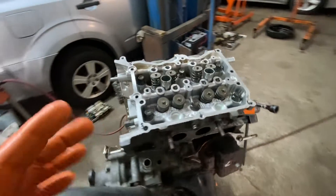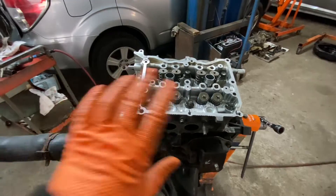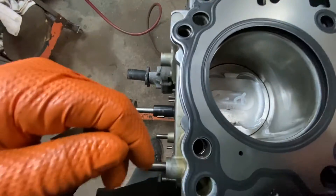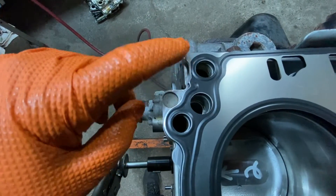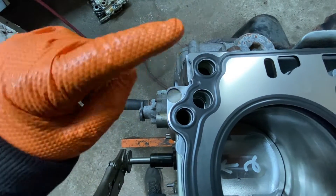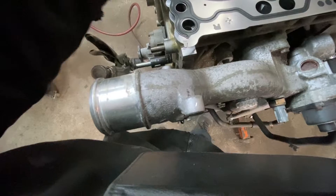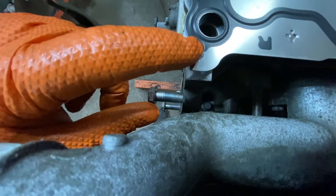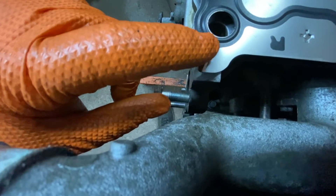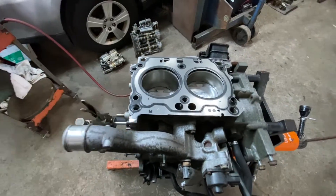Now I'm going to show you the other side. I'm not going to do it yet because I'm waiting for valves to come, but I'll show you. It's the same technique — putting the gasket maker on is just a little different. You're going to put the gasket maker right here from the factory black out, just a little tab on this side and the same thing underneath in this area. On the other side, from this black area, from the tip here to about here, make sure you cover the factory black on both sides. Everything else is exactly the same.